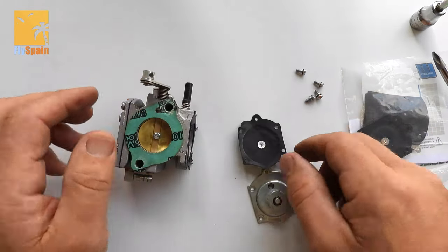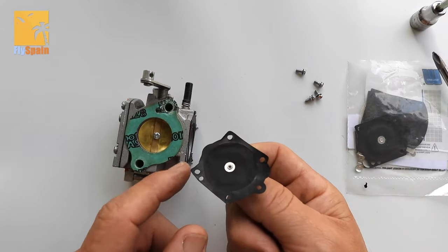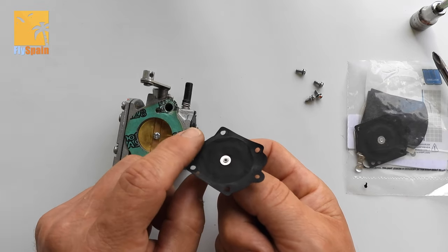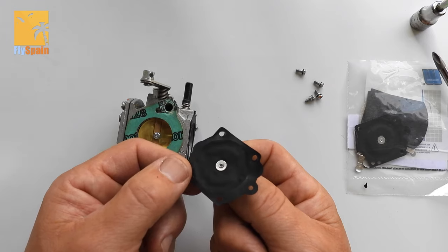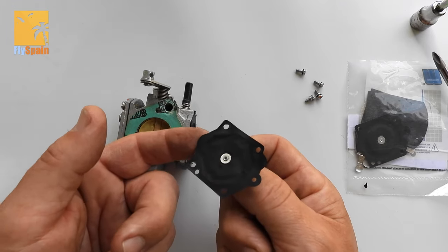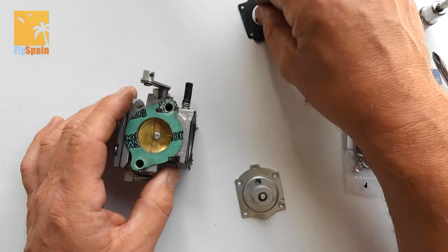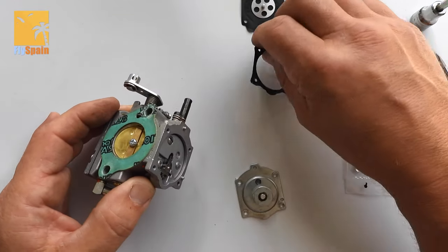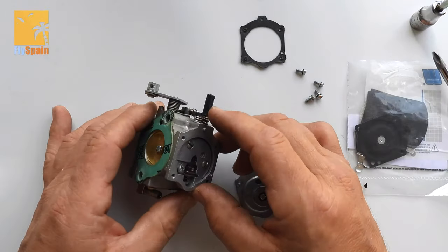Let's quickly look at this old diaphragm here. You can see it's kind of a bit saggy and baggy — that's just where it's stretched over time, and that's the weakness we're getting inside this carb and why we're going to refurbish it, because that isn't as taut as it could be. It's just tired with age really. So remember that went on the top of the gasket. Carefully pull the gasket away — I put all my stuff in a line, and I would suggest you might want to do the same.